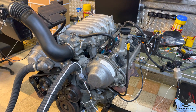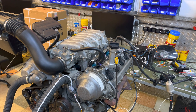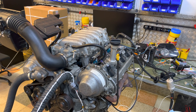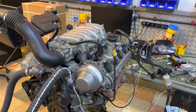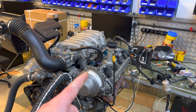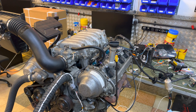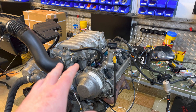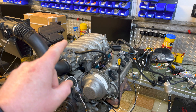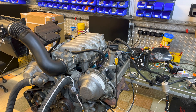We've had a couple of guys in various forums and Facebook posts who've been posting about random misfires — things that can't really be picked up or detected easily, and everything seems to be running absolutely perfectly other than that. It's a completely random misfire that can't be put down to a broken coil, a blocked injector, or anything like that. So, first of all, vacuum leaks — that's your biggest problem. Vacuum leaks means uncalculated air, meaning the mass airflow sensor is not calculating the air entering the engine, and that is what's causing the misfire — either too little or too much fuel in the system.